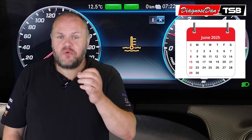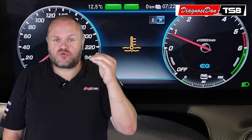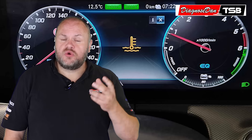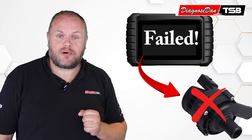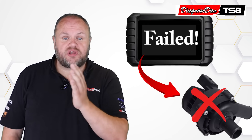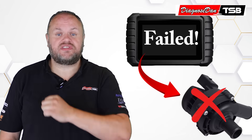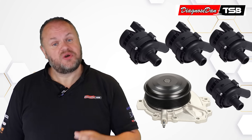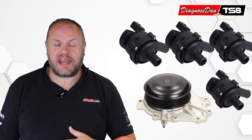After a lot of delays, finally after two weeks, the car rolled into the workshop. The coolant level was still the same — it hadn't dropped — but the warning in the instrument cluster for coolant level low was still present. Laurits hooked up Sentry and performed a guided test. During that guided test, Sentry evaluated the current draw of the electric water pump. It should have been between 3 and 8 amps, but it was barely drawing 1 amp — meaning the electric water pump failed the test. This vehicle uses five water pumps: three LIN-controlled electric water pumps, one PWM-controlled electric water pump, and one standard mechanically-driven water pump.